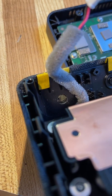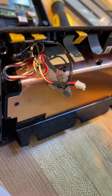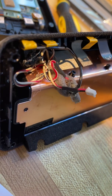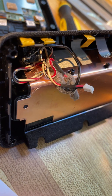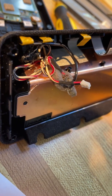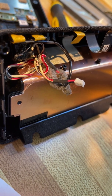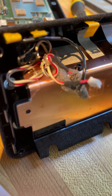Ideally you'll have a nut on the other end. Next I cut the red wire going to the speaker and wired it into the stereo plug, shorting the two positive leads together since this is mono, and putting the common ground onto the plug itself. One additional thing you have to do is add a resistor of about 16 ohms across the red and black wires to avoid a hum when you turn Alexa off.